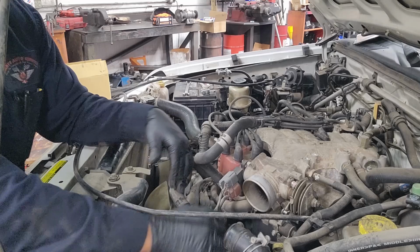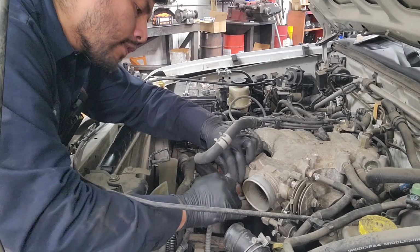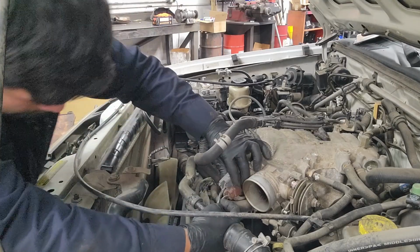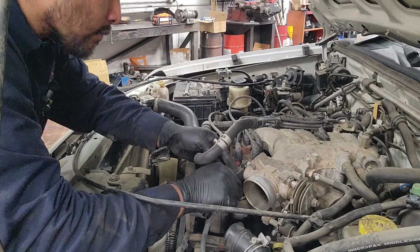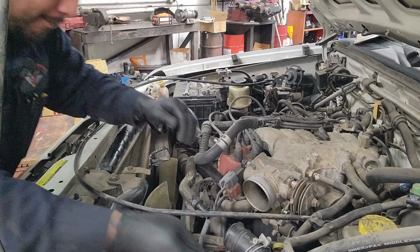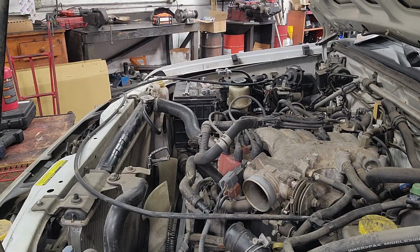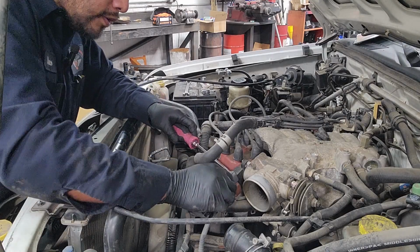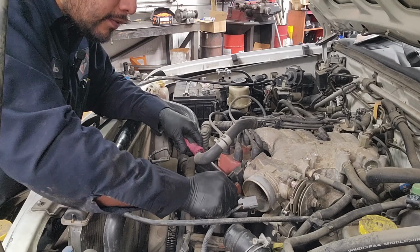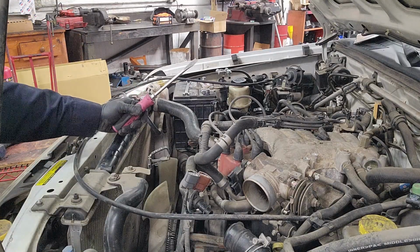As we continue to move things, disconnect things, now we're moving to the throttle position sensor. There's these 2 connectors. It's a little bit under. You can use a screwdriver to get in between the sensor itself and the connectors while you pinch, and then rotate so that it can help you remove these. They're a little bit difficult to get out of the way.